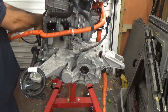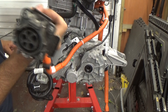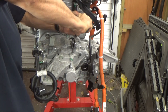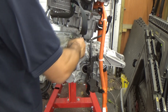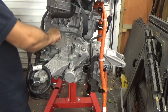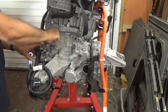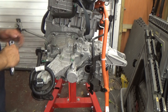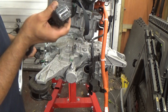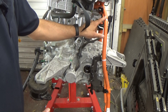Anything orange is high voltage — if you're doing any of this stuff, you probably already know that. This was the charging plug — this was on the front of the car on the Nissans. I'm going to go ahead and take these other bits off that I don't need. This must be the gear selector switch — this is a switch that goes into the gearbox. This must go into the ECU, and this plugs into the main wiring harness. Okay, that's all stripped off there.